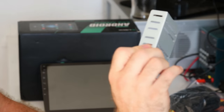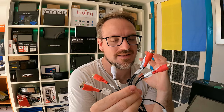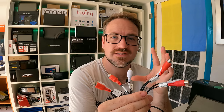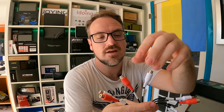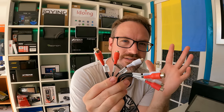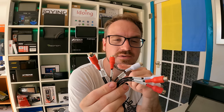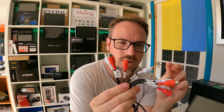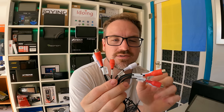Also in the box we've got some brackets, three USB cables, and a loom that has eight pre-outs — it's a 5.1 system. That's awesome. Very few head units have this. It means you can have a separate center speaker, separate subwoofer — two subwoofer inputs left and right, two center speaker left and right, then front left, front right, rear left, rear right, all on different pre-outs. It'll be very interesting to see how the software deals with this setup, but if you're watching movies or anything with 3D sound it will literally work fine.